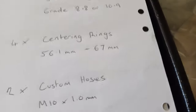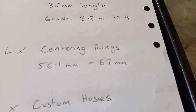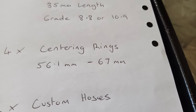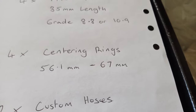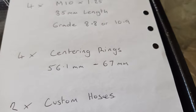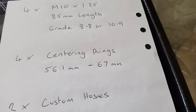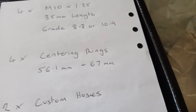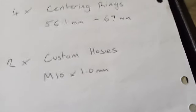You need four of those bolts. For centering rings — the Daihatsu hub size is 56.1 and these discs are 67 millimeters in the center. A good company to use is Laser Master; look them up online and you can type in exactly what you want on the website, select stainless steel, and it won't be expensive. Actually, you only need two centering rings, not four.